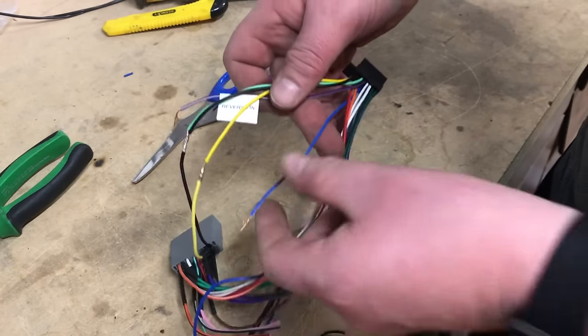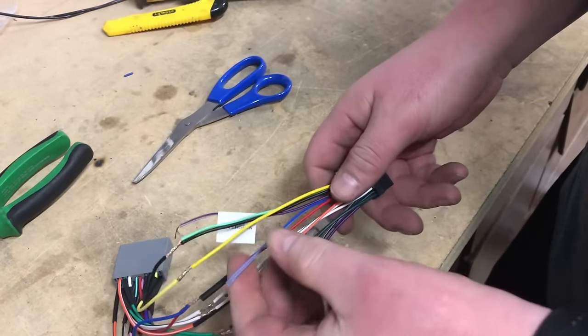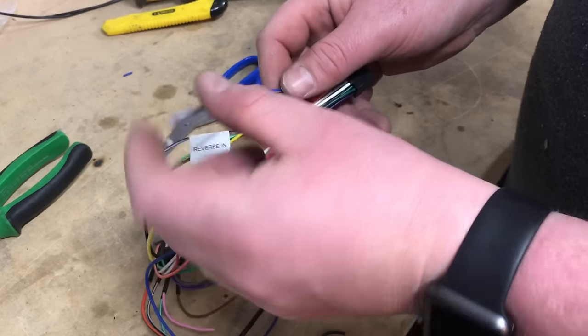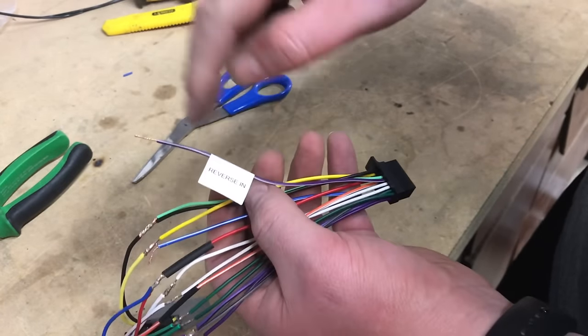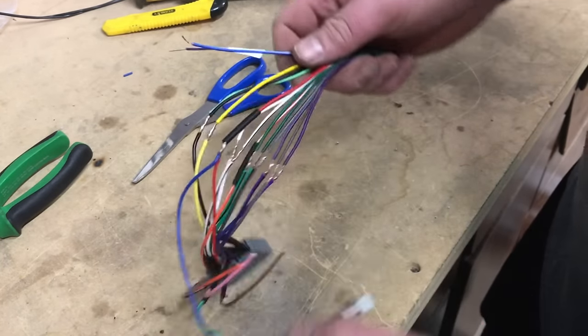Everything else is color for color. Blue white is your amplifier turn on. We don't have an amplifier to turn on, so we're going to put a butt connector on there just so we can access that down the road, but that's also nice and insulated. And purple white, we are doing a backup camera, so we will ensure that we connect into that, but that's going to be a separate video. We'll have a link down in the description for that.